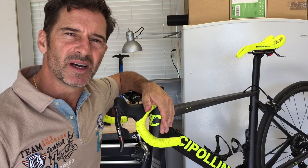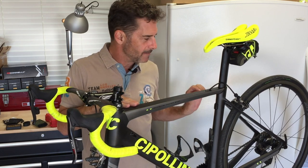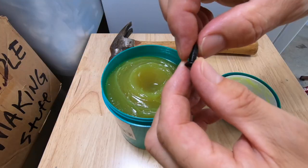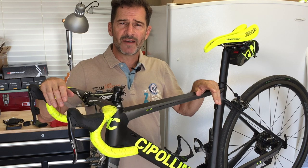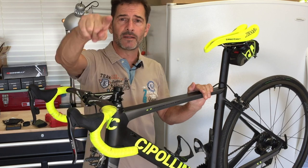It took me several weeks, mostly due to lack of diligence on my part. Key learnings: number one, I stripped the threads out of the top of the Torx bolt because I wasn't paying the necessary care and attention. Number two, use the right tools — sharp drill bits, the correct extractor. It's worth spending a little more to get the right tool. And always, always grease your bolts — if I'd put grease on in the first place these wouldn't have gotten stuck so hard. Thanks for watching — always a pleasure to have you here at the Pez YouTube channel. Click subscribe and hit the bell for updates. Till next time, this is Pez out.